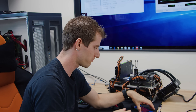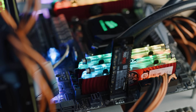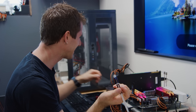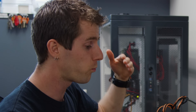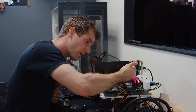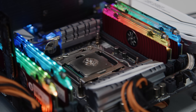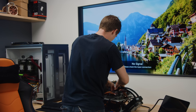The rules of the game have not in fact changed. RAM doesn't really need cooling unless you're extreme overclocking it to break records, and heat spreaders don't really do a whole lot for it regardless of their design. The best way I could describe it: the water on the top of these RAM modules is not hurting anything — it's like homeopathic pills where they just contain basically nothing — but it's not helping anything. To say that it is water-cooled is about like saying a CPU with a bubble of water on the middle of it is water-cooled. Water does not inherently cool anything — you have to have surface area. That's why water cooling still needs radiators, and that's why heat sinks need fins and not just heat pipes. Well, that whole thing was enlightening. Isn't learning fun?